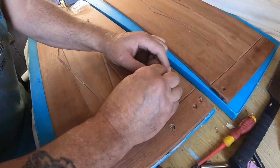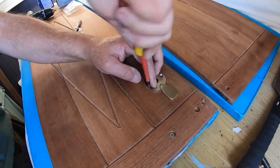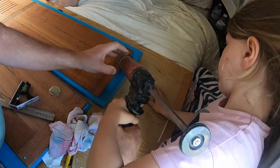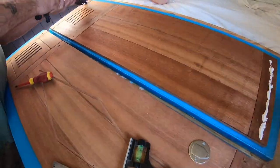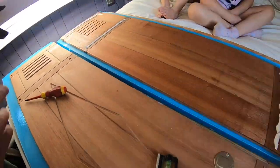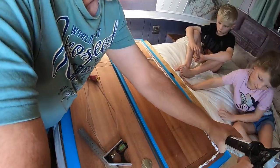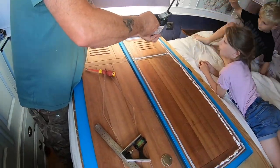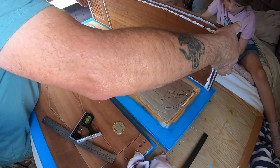So with the door with the lock on, we've only used the butyl, so we can take that off if anything happens to the lock and we can get to the lock behind. But on the other door, we're using the glue on the rail bits and up that centre panel, like what we did on the other hatches. That secures the door in a little bit more, but we're still putting the butyl all around the edge just to help stop any water ingress down the back of those. And then this job's finished.